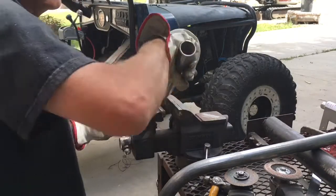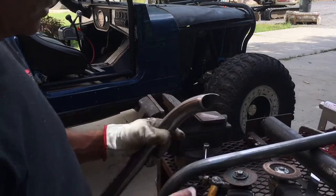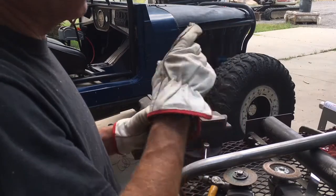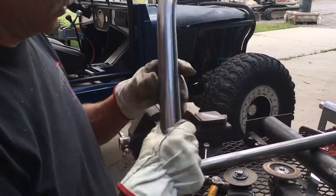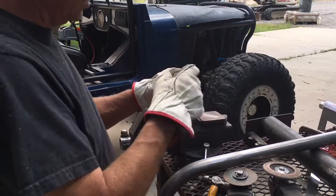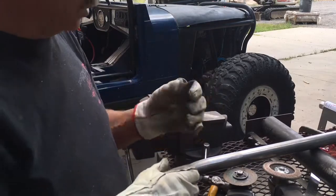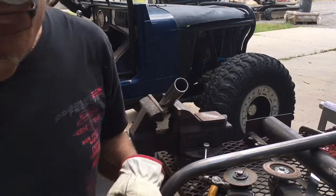What I've got is the driver's side done. You can pretty well see the notch that it took. I had a 75-degree bend and I just bent it until I liked what I saw - snuck up on it and took my time so I didn't have to remake it. Now on this other end, because it's going to be bolting to the frame with a bushing, I need to put a nut inside here and cap that off. What I'm going to get is a washer that'll fit in there, weld the nut to it, set it in there, and then weld it to the pipe. So that's my next step.